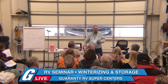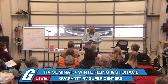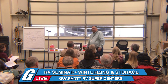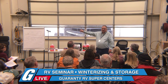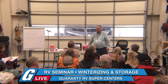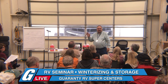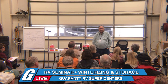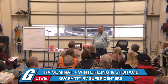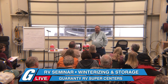The question is, she was told never to put more than 40 PSI in her coach, and that's not really quite true. Our campground is at 59 PSI, and we've spent a ton of money with the city making sure that we had the latest equipment to hold that pressure. It will not go over 59 PSI, and I don't think it's ever been under 59. It's a very steady pressure.